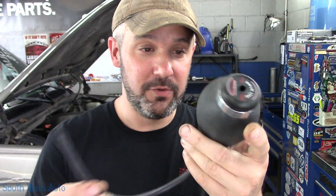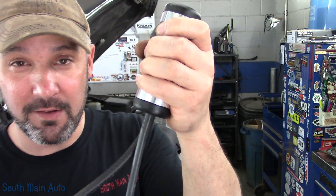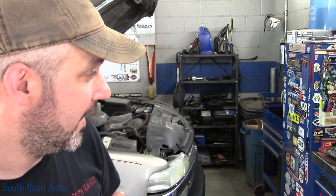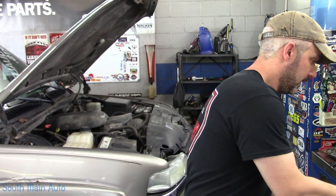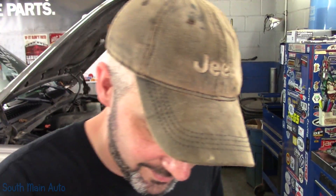It then gives you the ability to apply smoke through that hose and plugs off the intake. Then you can just let it down. You can also use this to plug off the exhaust pipe if you're trying to find leaks in the exhaust — in a cold exhaust. If you put a smoke machine on a warm exhaust, the converter gobbles it up and you'll never find a leak. It also comes with a big bit of kit — we'll get to the meat and potatoes of this diagnosis.